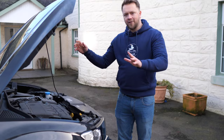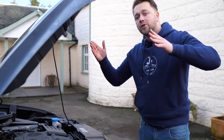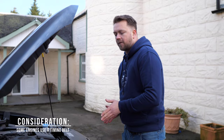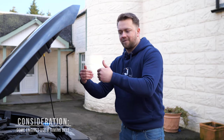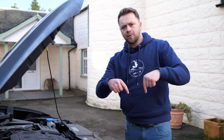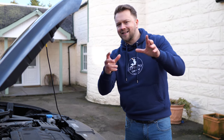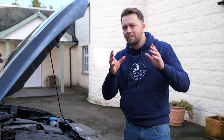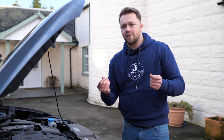A quick note I forgot on the engine front: depending on the engine size, some of these engines use timing chains and some use timing belts. Drop a comment below with your engine size and I can let you know which one you've got. The service intervals tend to be five years and 80,000 miles for the belts — it costs money and it's labour-intensive. For the chains, again, usually it's life of the car.